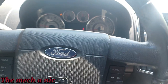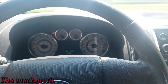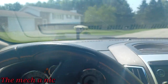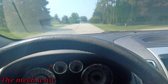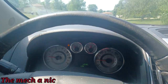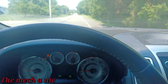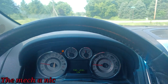Just got this Ford Edge dropped off — I believe it's an 07, primarily a brake issue. They said there's a noise and a brake warning light on the dash. I've only driven it about 15-20 feet and I can already hear a noise. That sounds weird guys — there's like a sweet spot of around 17-18 miles per hour where you really hear it. It sounds like front left to me.